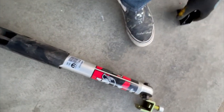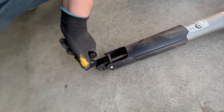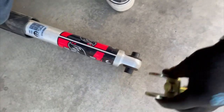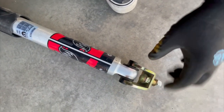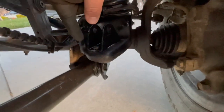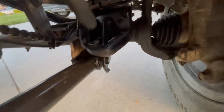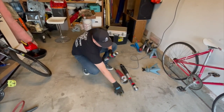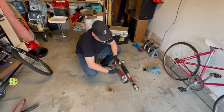The bottom will fit on there perfectly, so we don't have to do anything there. But on the top, these on the Jeep come extended out, so this is not gonna fit — we're gonna have to cut it. The bottom is in loose; I haven't tightened it yet, but it uses bolts with nuts at the bottom and those just fit right in perfect. On the top end we have a bolt that goes through without a bushing — it'll be tightened up there. The way I'm going to put it is so that when the shock goes down it won't bind up. We do have to cut these to fit, which will be pretty easy with the grinder.